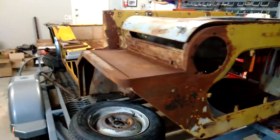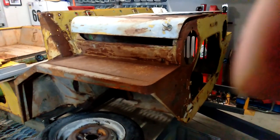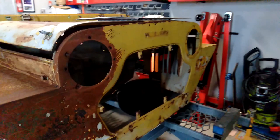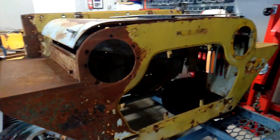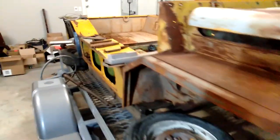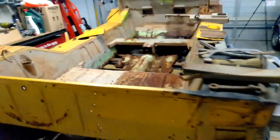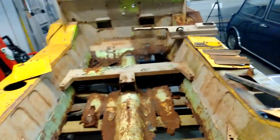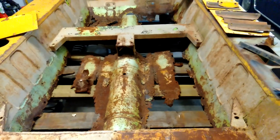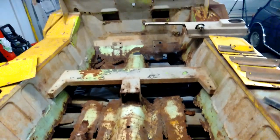There's a lot of surface rust on some parts — it needs to be taken back down to bare metal and then primed. There's a lot of places that just need a bit of panel beating repairs as well. There's a fair bit of rust in the floor, and the plan for here is it's easier to just replace the entire floor panel with one whole new section.